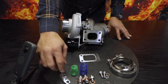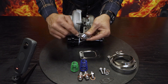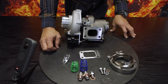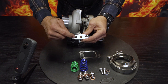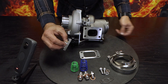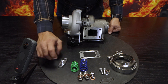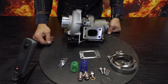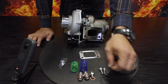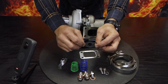Included in the package you'll get a multi-layer three-layer stainless steel MLS gasket, your two springs, your Bullet oil return fitting with a male return fitting with the dash-8 AN internal structure. You'll notice the mounting holes are slotted so this will fit your T25, T28, GT30, and GT35 style turbochargers. You'll also get your water-in and water-out one millimeter oil restrictor fitting with copper washers.